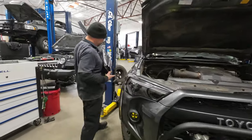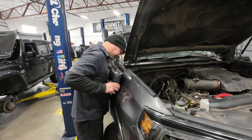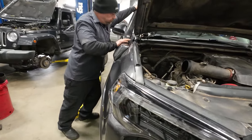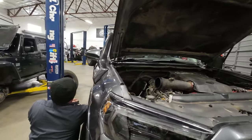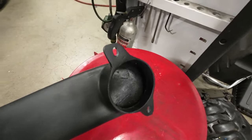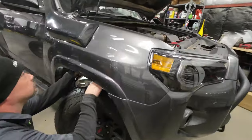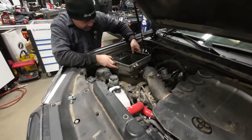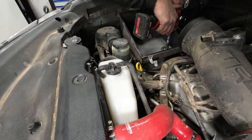Jeff was satisfied with the way everything fit, so he's going to do the final install now. Once he aligns those bolt holes, he's going to press on it and make sure that double-sided tape sets exactly where it should be. Then he's going to go into the inner fender and secure two of the bolts. Once those two bolts are secure, he's going to get the inner tube that connects to the air box — you can see those also have two bolt holes. Those will be connected to the last two bolts in the inner fender, and that tube will poke right through the inner fender and into the factory air box.